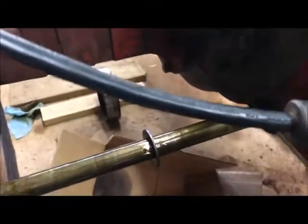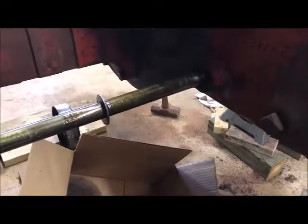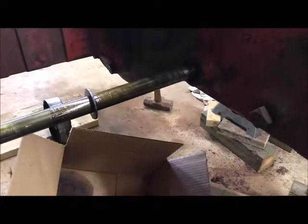Okay, a lot of touching up on the other side and tapping lightly with a hammer and a punch, but you see it's coming out. The main problem was there was a burr on the other end, and then a slightly bulged edge on the far outside edge. Well, I'm sitting here talking while I should be working on extracting this, but it'll be out in a few minutes.